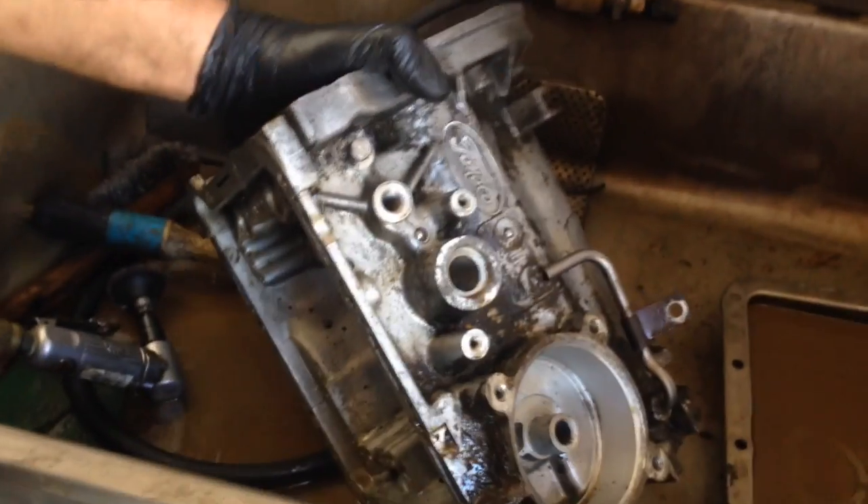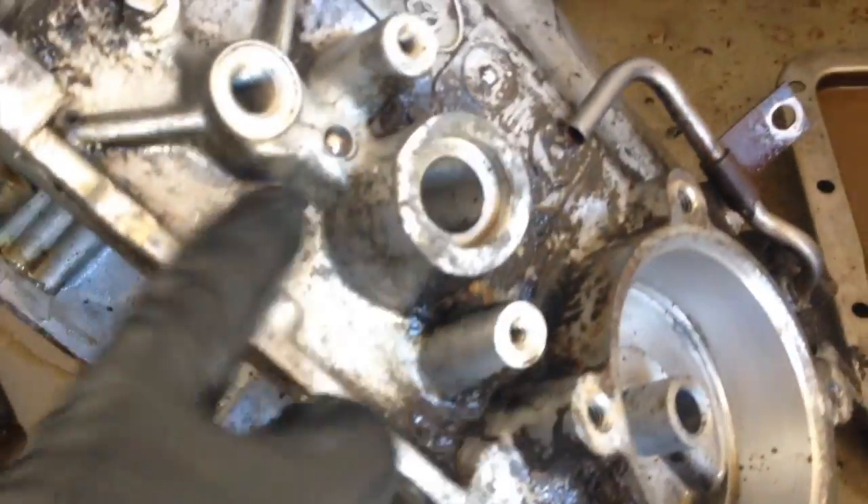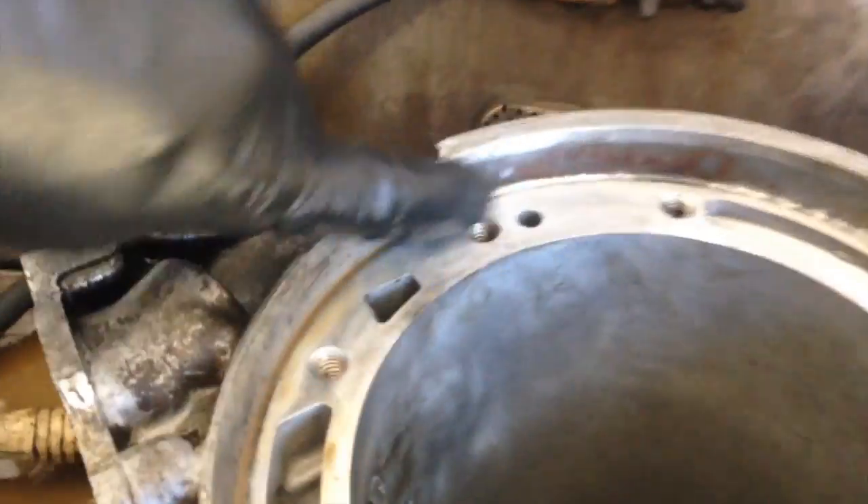Okay, this is a C4. It's a 1967 case — it's definitely original. But what happens after they sit for years and years and years, they get rust accumulation or water accumulation on them and it causes corrosion on the aluminum. The most serious part is where the front pump sits in. I've got to try to get this out of here by hand and not damage the surface — that means I'm going to do a lot of polishing with some really fine grit and work it out.